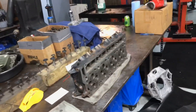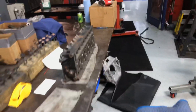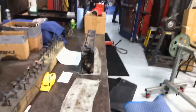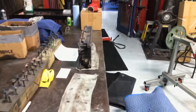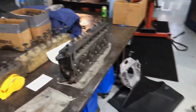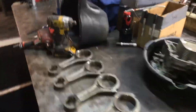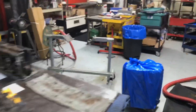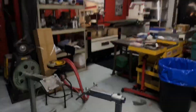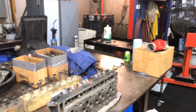The main thing we need to know is how much we're taking off the heads, and then we'll account for that in the block too. There's so much play in the hydraulic lifter but we might as well put back what we cut off — in the push rod length — because the push rod is the main thing. If we change that push rod we can cut anything we want, barring the piston hitting. Getting the oil pan going. That's the update — it's a disaster back here, so time to get to it. Have a good day guys.